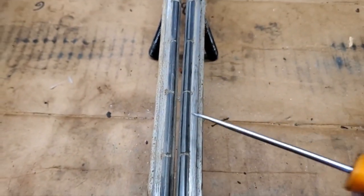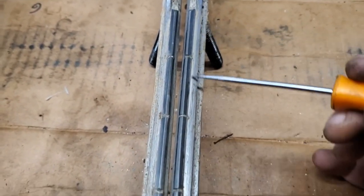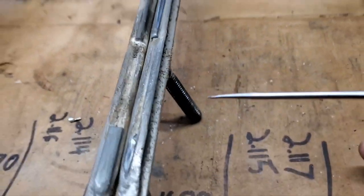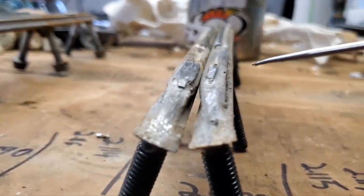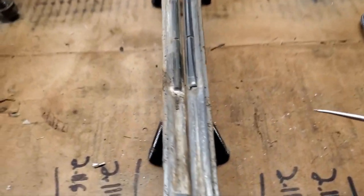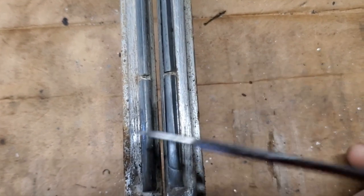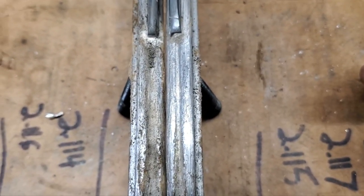So these are 6-inch shaper bars, by the way. 6-inch meaning the carbide length here is 6 inches. And shaper meaning it's got this concave shape on both sides. That way, when you're turning, it kind of cups the snow and helps push it. But anyways, you can see there is some uneven wear here. I could just rotate these and be fine.